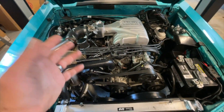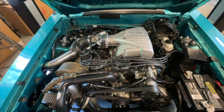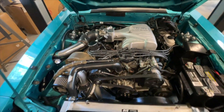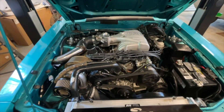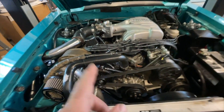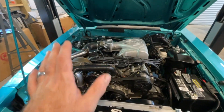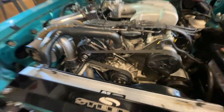As you can see, we kind of cleaned some things up. I got rid of the heater tube that runs across right here, because we're never going to run the heater in this car. It doesn't get that cold down south and this car isn't going on long trips. We just left that out and cleaned it up. Right in there you can see I basically cut the snout off and welded everything up tight so we don't have to worry about that. I also looped the water pump back around on itself and did a few things underneath the car with some wire loom.